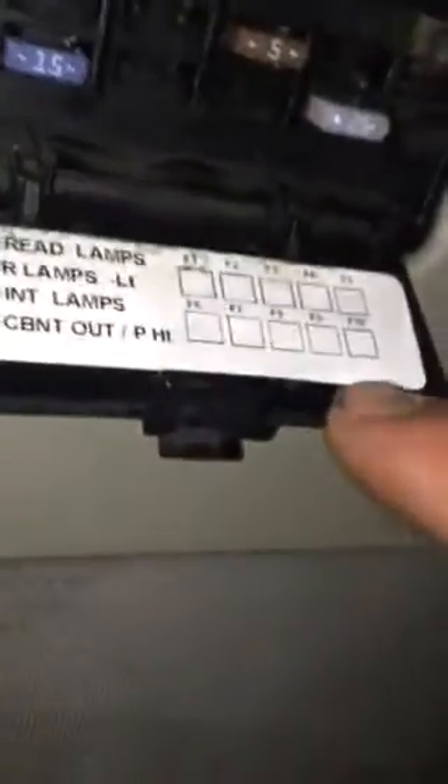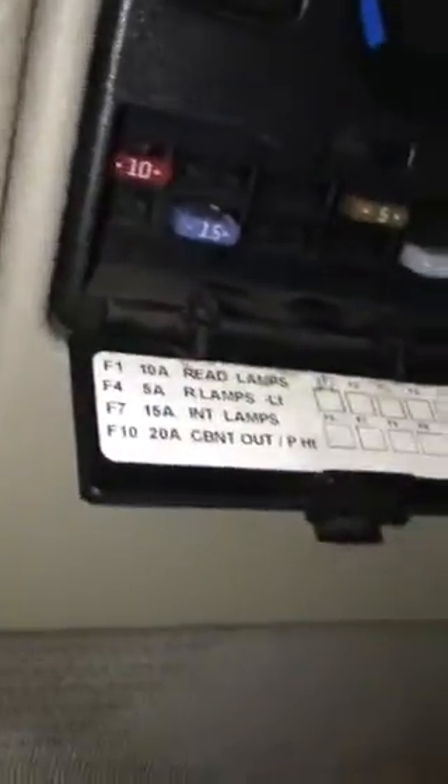But if you're having problems — find it for your light controls, anything like that, or your 12 volt port for your plug — just go ahead and go here, go to F10. Like I told you, lower hand corner, try it. I challenge you, at a 25, you don't have the issue and you're not going to blow anything, fry nothing. I hope that's of some help. I know there's a lot of issues online with people looking for that, and they can't seem to find it because they're looking in the main fuse panel — there's nothing back there. You can try every sleeper fuse you want, you're not going to find it. I hope that was a bit of help. Thank you.